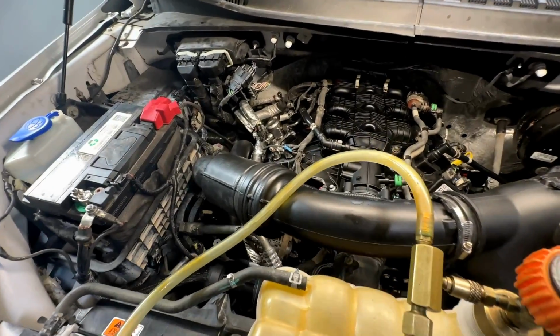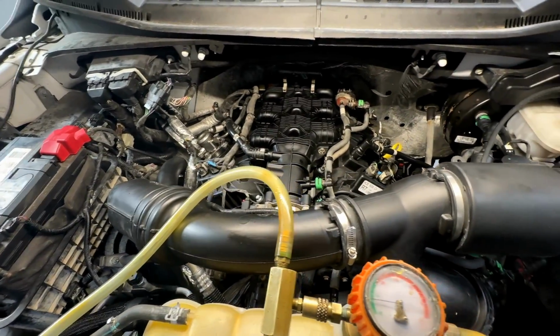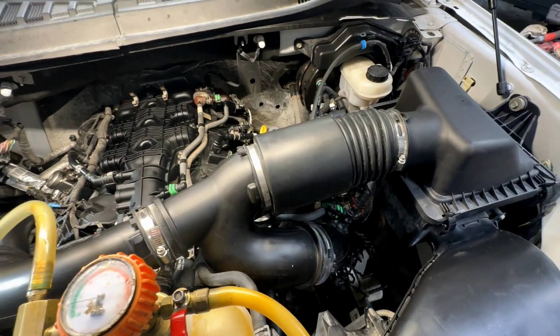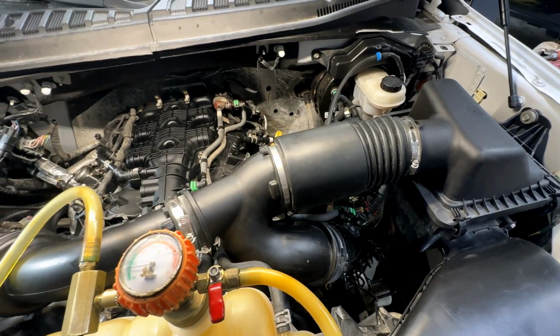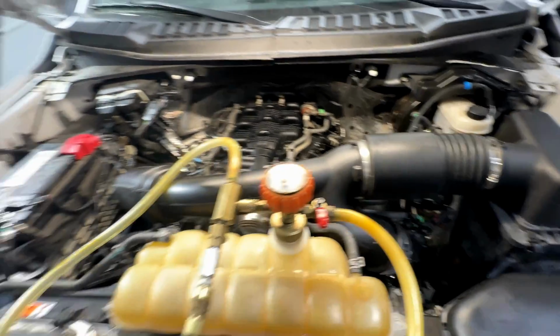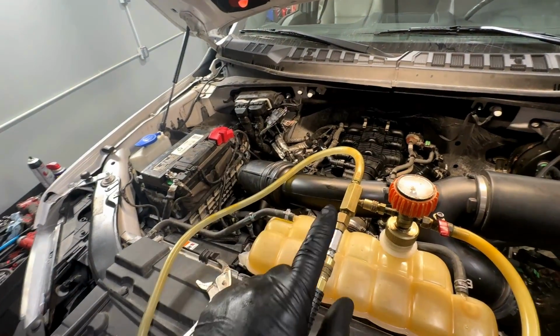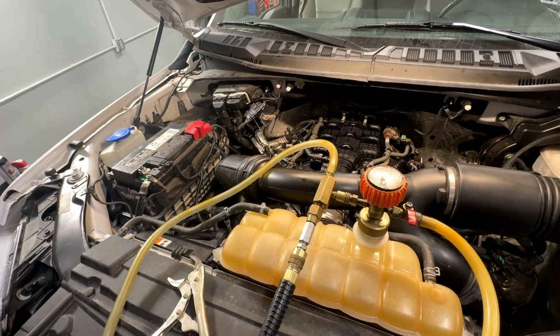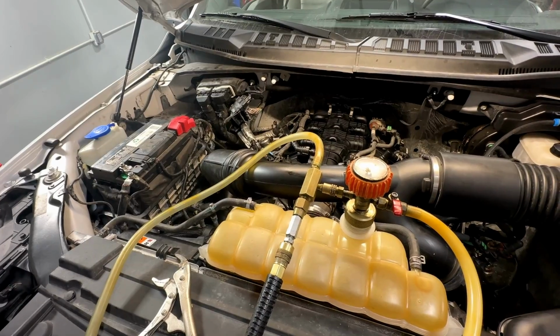So I came in today and put all the engine compartment stuff back together. We're still holding vacuum. Engine oil is filled. Belts are on. We need to make sure we pull the fuse for the fuel system so we can crank it for a while and get it priming in the oil system there.